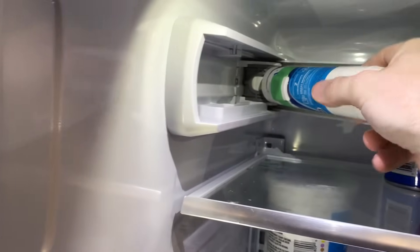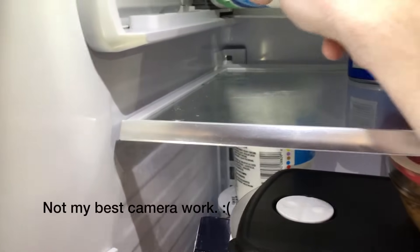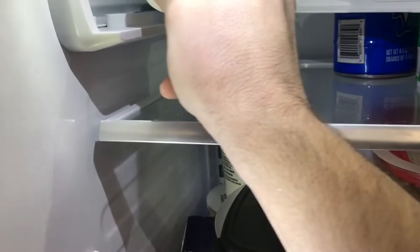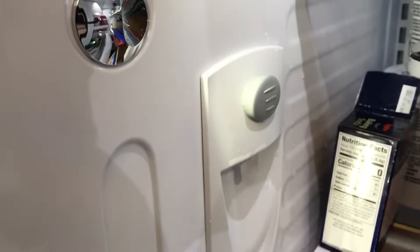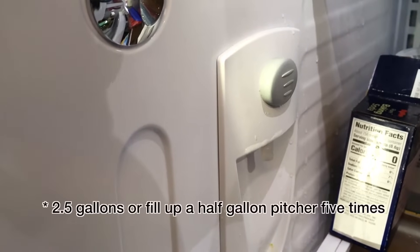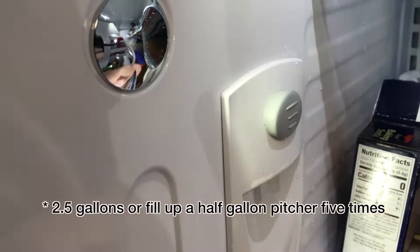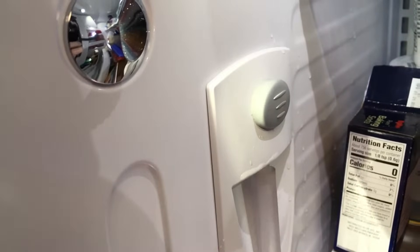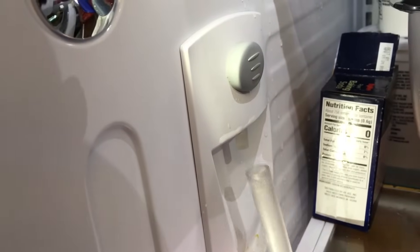Back at the fridge — I'll press the filter in there. Got it in. Now I can try it. So that leads me to my next point: you need to flush this filter. I think it's five gallons — you can read the instructions with the filter to find out exactly how long. With this style that's on the side of the inside of the fridge, I use a piece of 3/8 inch hose, stick it up there, and set a pitcher down below to route this into so I don't have to hold the pitcher right up there. It gives me a little more control. That's why it splashed out and made a mess.